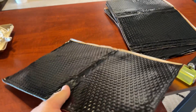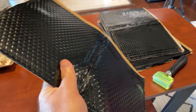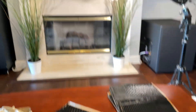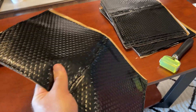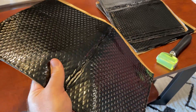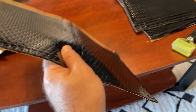The idea behind this is it's a noise damper system — it changes the mass of whatever you stick it to. When you have a piece of sheet metal and you hit it like a gong, it's going to resonate. That's the problem I have now. If you make the mass substantially heavier, it drops the resonant frequency of that particular part way down. So instead of going 'ting ting,' it just doesn't make noise. That's the idea behind this.